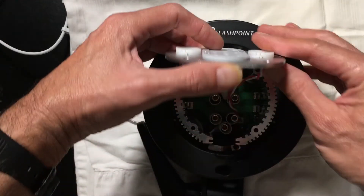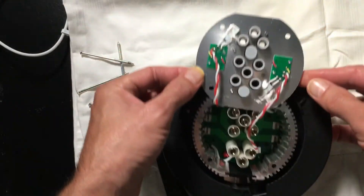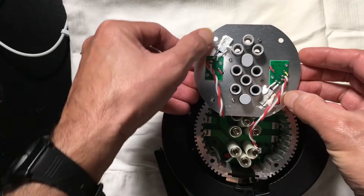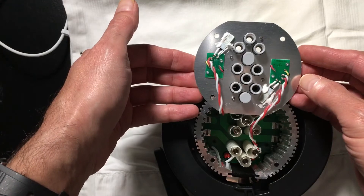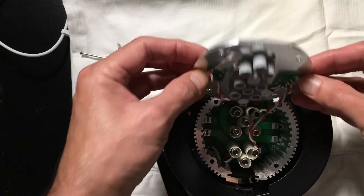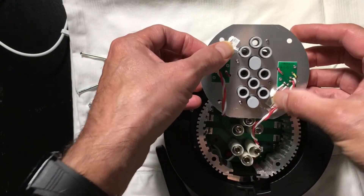I've removed those four screws and I'm going to pull this up to expose the internals. You'll see it's actually a nice design. There are two circuit boards here, one for each of the LEDs on the front. These square packs are actually thermistors that shut off the LED if it starts to overheat against these heat sinks. If we don't dissipate the heat passively enough, these are designed to shut down if they overheat — at I believe 65 degrees Celsius.